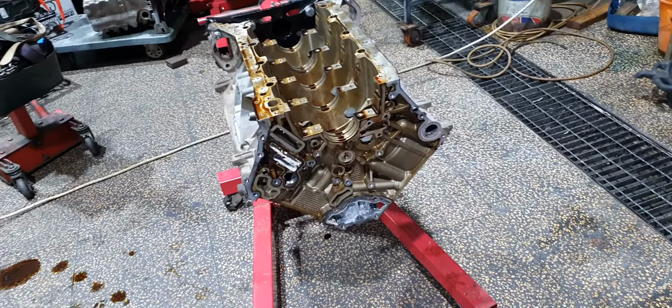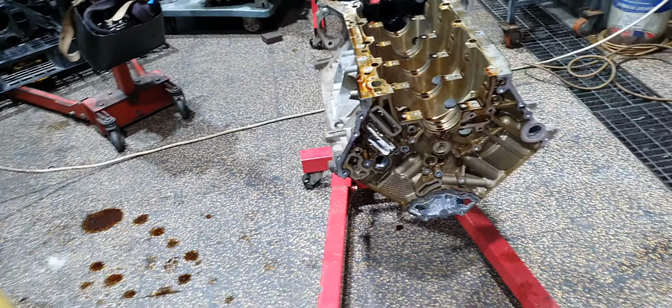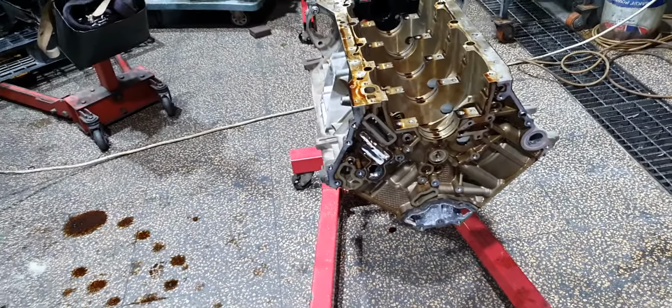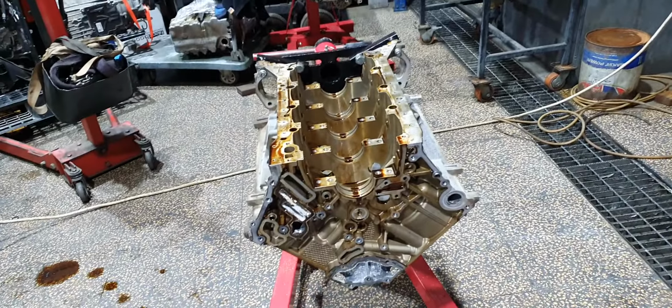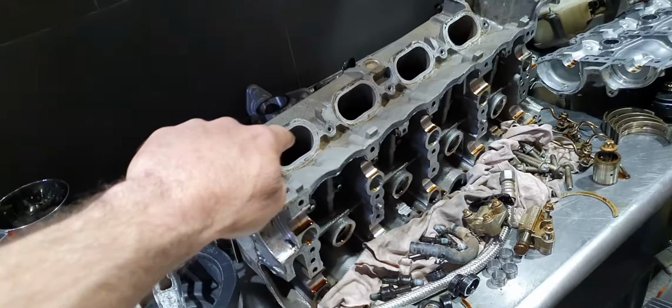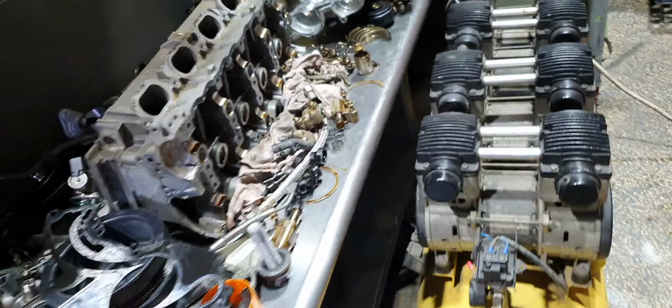So we end up to have a full build. Oh boy. One difference, because I made a leak test yesterday on the previous cylinder head that had the other engine, and it was not leaking the valves. I mean, when you put petrol from the inlet port or the exhaust port, it's not leaking, and the seals are new. I already opened it. I have it inside the engine room. Let me show you. Let's go to see there.